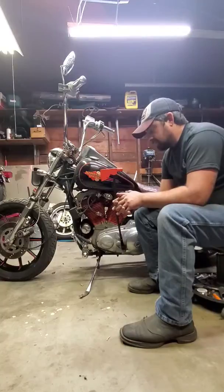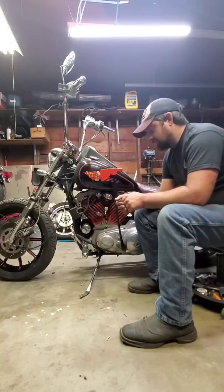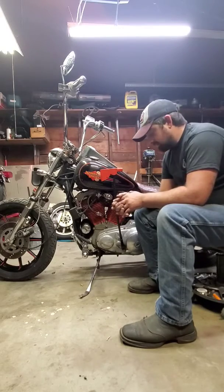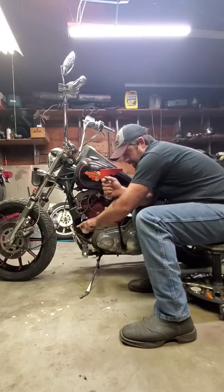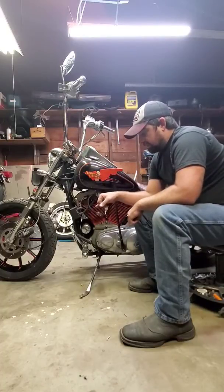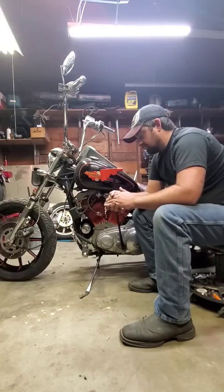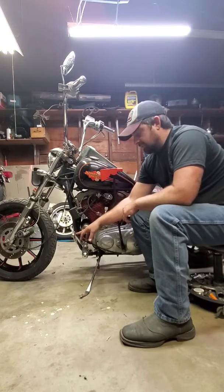I got on YouTube, and there's a couple gentlemen on there showing how they were shortening up throttle cables and things like that, and how easy it was. I watched a couple of those tutorial videos, and bam, it wasn't really that hard. All I did was take my old clutch cable and snip it about the length where I wanted it. This is actually a round loop that sits up on the handlebars on the lever, that pin runs through there, and I drilled a hole on the back side of that. I can put all the information in the comments below on the size of the hole and all that. I just found the dimension of the cable and went a little bit bigger than that, so I could slide it through there.